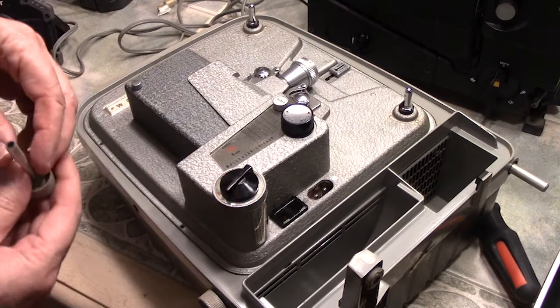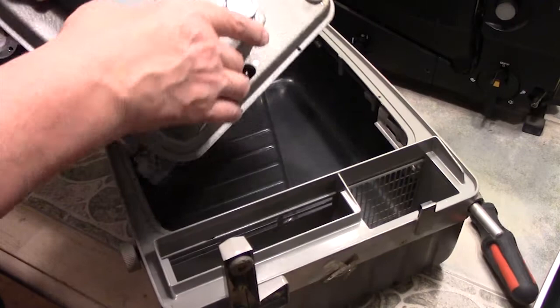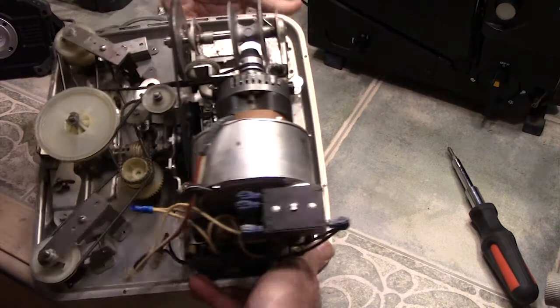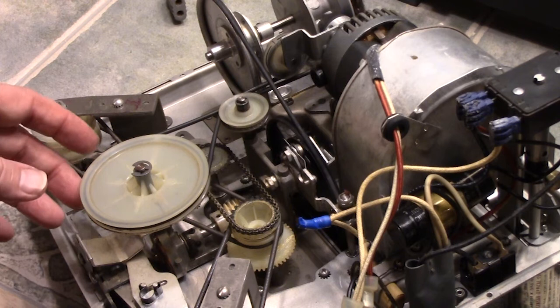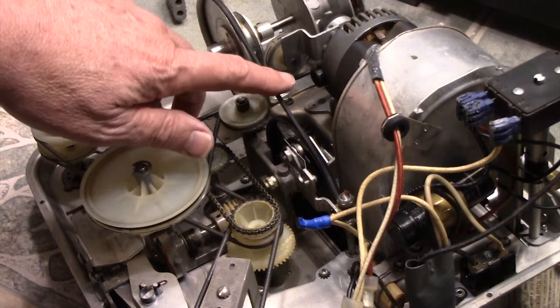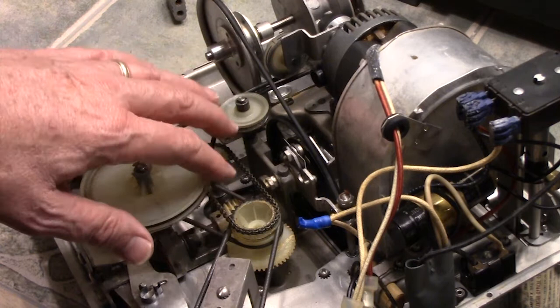We'll come back after I get all these screws out. So we just pulled this knob out — it seemed like it just pulled right out. Once that's out, you can actually pull this whole mechanism right out of the machine. Looking at the back, the machine has a lot of belts. There's a belt that goes around the back of this pulley and does a little U-turn around the motor — I think that's the main drive belt. And then the one for the shutter. Literally, this was the only thing that was wrong — this belt had come off. All I had to do was put it back around the drive and everything came to life.